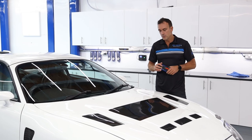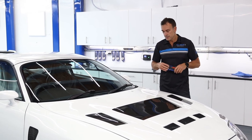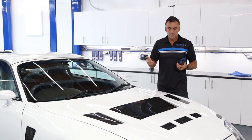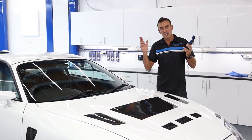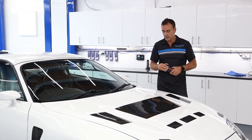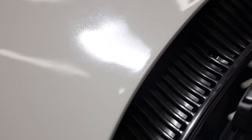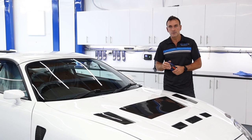It looks terrible. So literally the safest way here, because we can do that here at Lake Country, is we have a spray booth, we have the knowledge, we have the equipment, we are masters of paint, been doing paint for 20-30 years, you know, painting and restoring cars. I did tell the customer when we brought the car in, look how bad this is. The rest of the car has got healthy clear coat. This doesn't even look healthy to me. I know for experience, if I try to measure it, it's pointless. It wants clear coating again.